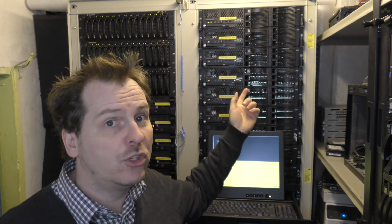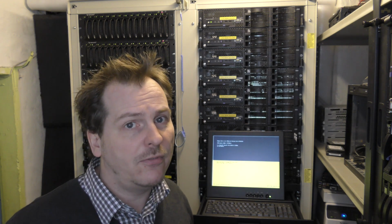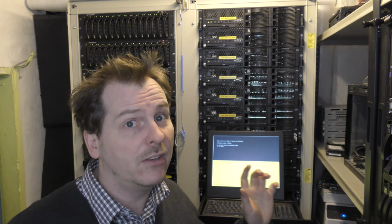They often come with 2 quad cores and a fair amount of memory, and you can just buy some more RAM for them. They can hold up to 48 gigabytes of RAM, 2 quad cores, so you can build a rather big VMware server, and the free license will cover that just fine. And it comes with a web interface. I didn't know that. I thought we were going to do something completely different. Usually there's a link to downloading the client in there, and that was what I was going for, but then it started a web interface, so awesome!